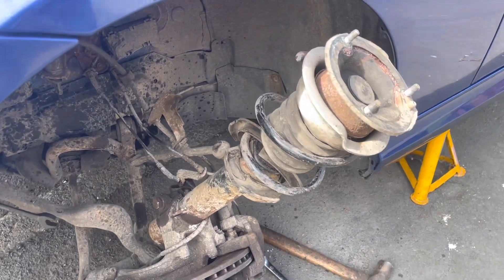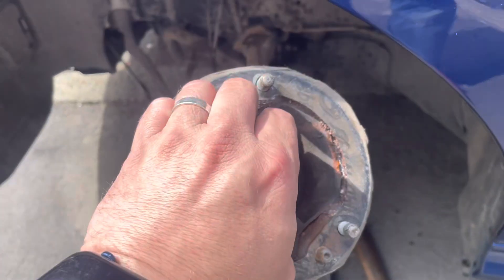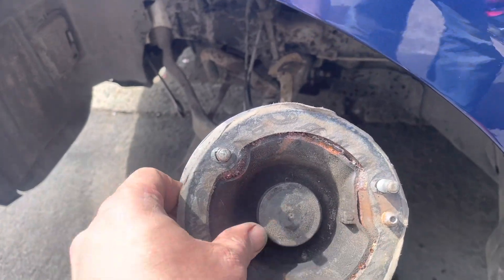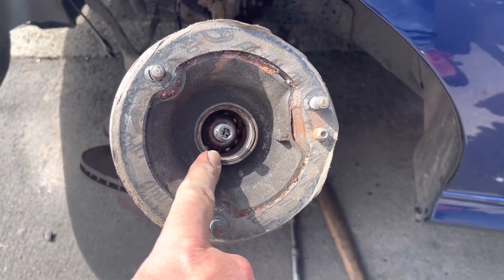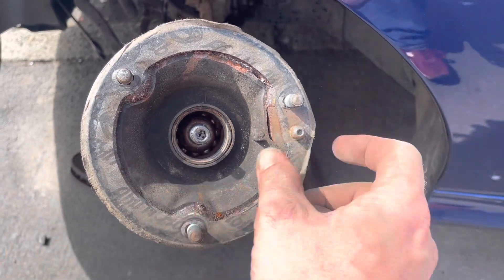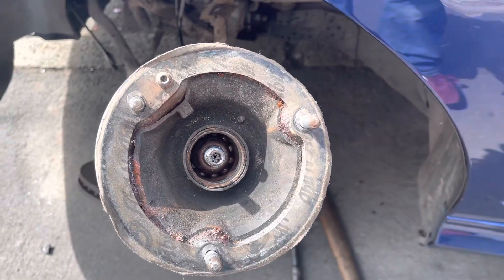You can see how ruined this suspension spring is. What's left to do now is remove this little rubber cover at the top. Inside there will be a little 19mm bolt — there's an Allen key head in there and then a recessed 19mm. Once this comes off we can get to the spring.